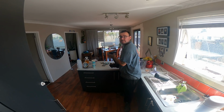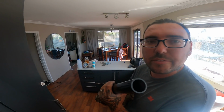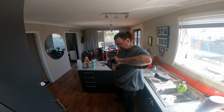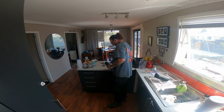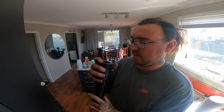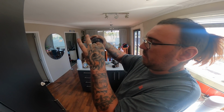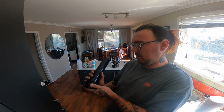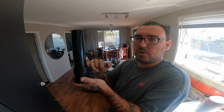Alright, I've been working out the best way to set up the camera so that instead of trying to hold everything and do it all at the same time, we have our turbo there. This one here slots over the turbo nicely, then that one slots over that one. At the moment there's a little bit of a gap, but by the time that is expanded out, we're going to cut this off here and put a clamp across both of them, which is not ideal. It's not something I enjoy doing or recommend doing, and then that can go back into our stock intercooler piping instead of the Hori setup that was on there, that I'll show you in a second.